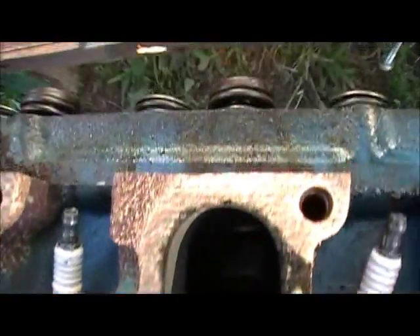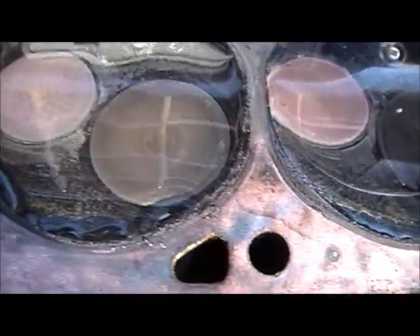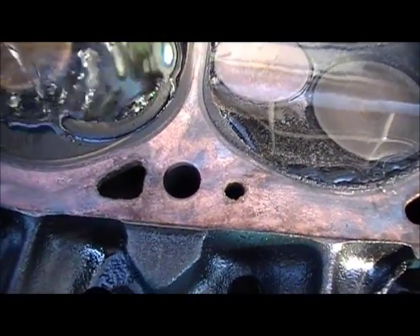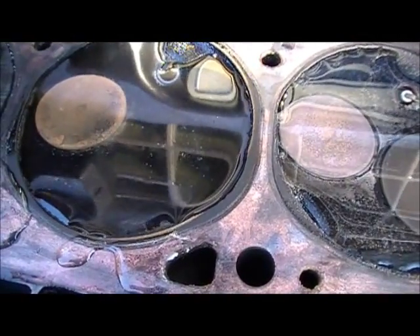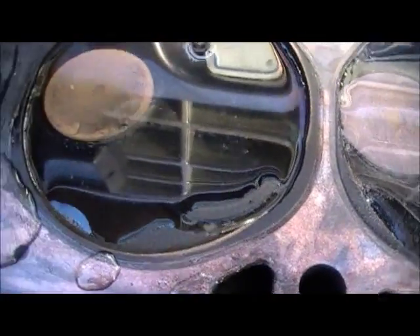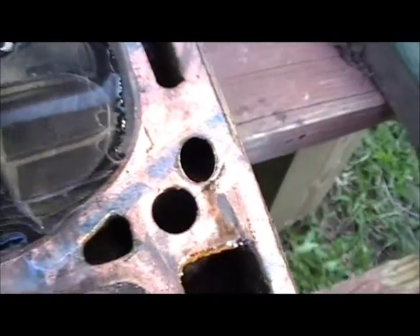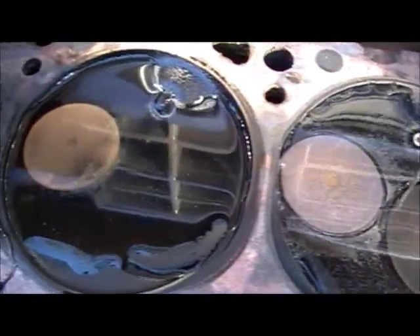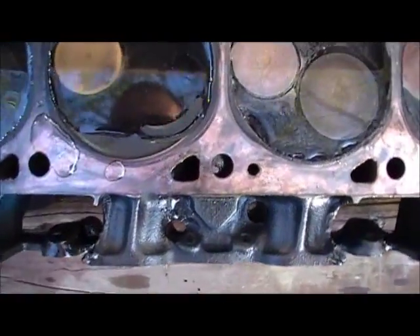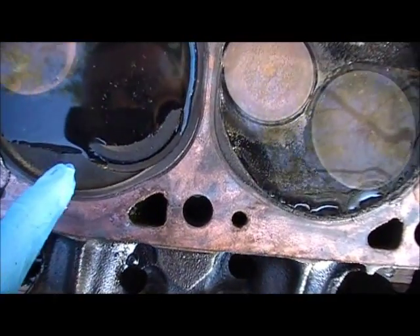We'll go ahead and pull the valve out and have a look at it. I don't know if anyone has ever seen this — this is how you wet check the heads. You can see number six right here; it is not holding water. Let me fill it back up — you can actually watch it run down, while the others are still holding the same amount of water you pour in. There's also another way where you fill them and get a piece of plexiglass, lay it on them, and kind of compress it. You see that a lot in performance modifications. But we can see that this here is the problem.